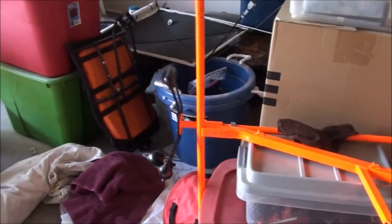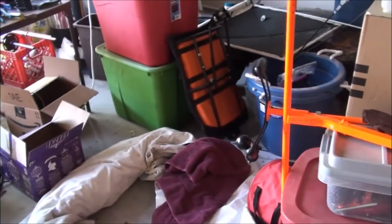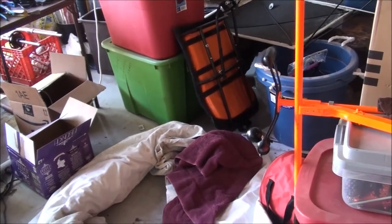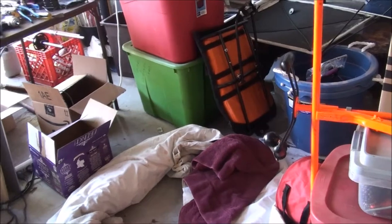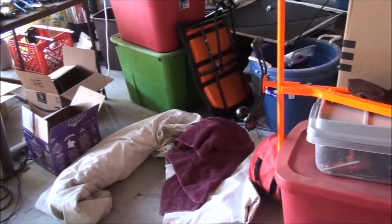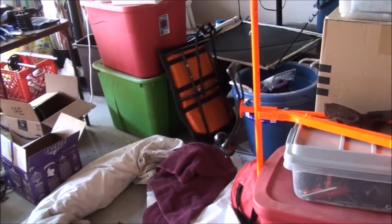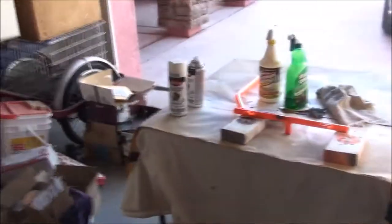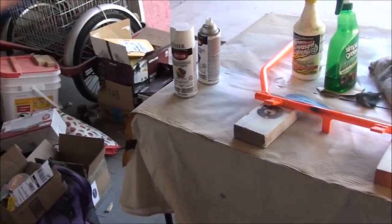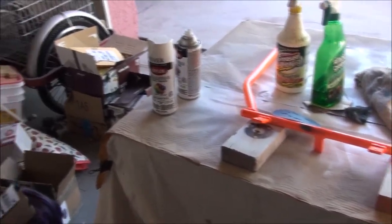Basically what I'm gonna do is paint the frame by itself - primer it, then turn it right side up and primer the other side, turn it upside down, paint the bottom side, then turn it right side up and paint the top side. Then mount this, tape off some of the stuff, tarp off the bike, sand it, and paint it while it's on the bike. It'll be a lot easier. I'm probably going to go down to Home Depot or Lowe's and see if I can find that orange paint. I need to get some more primer.